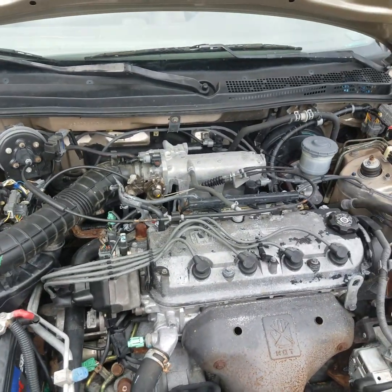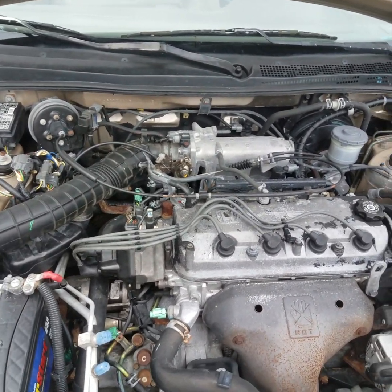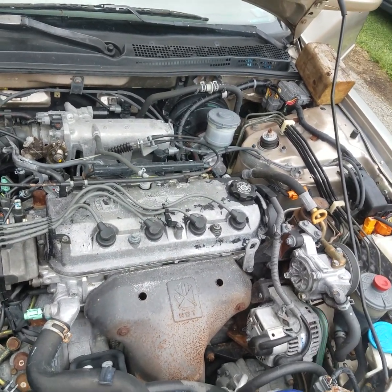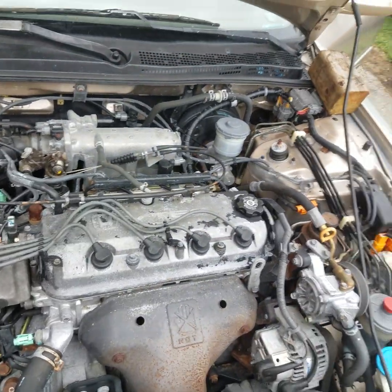You've got a car that's running like crap with no check engine light on, so you've got no way of diagnosing it as far as reading trouble codes. If it's got a misfire, pull the plug wires out. If it stays running the same, you know you've got a bad plug wire. If you pull one out and it falls on its ass, that means that plug wire is good.